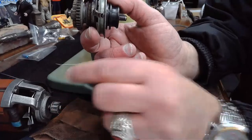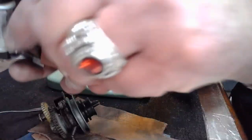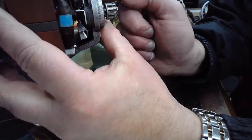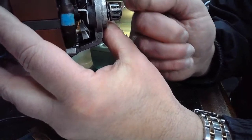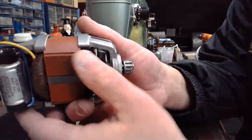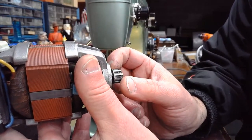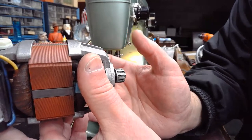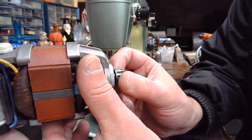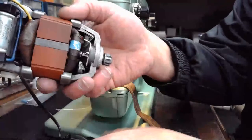to happen is, even if you're able to operate the machine, this motor, instead of being positioned true and allowing that belt to run in proper alignment, the belt is going to be running a little bit, as my father would have said, cattywampus. Not sure that's a real word, but I believed it was because Dad said it all the time. But it'll allow that belt to not run true over to this pulley over here.